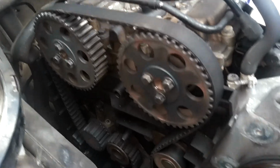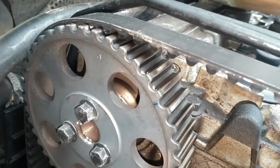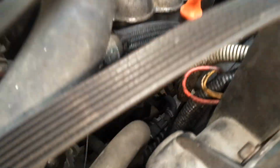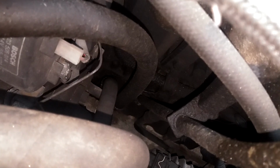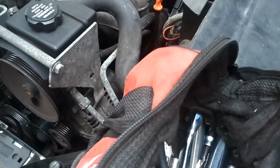We are at Andrews doing the timing belt water pump and there's a lot of oil under the car. So we're going to do these front cam seals. They're seeping a little bit, and we're going to go ahead and do the oil cooler line block off, because there's some oil wet on those lines down there, and these are sweating up here. And then we're going to do rear cam seals and a couple of coolant hoses.